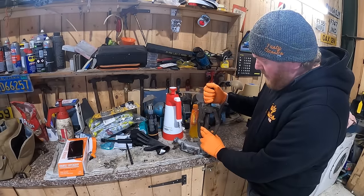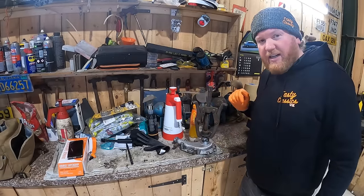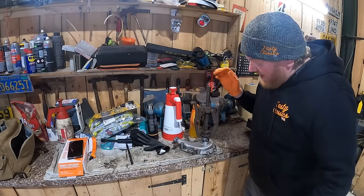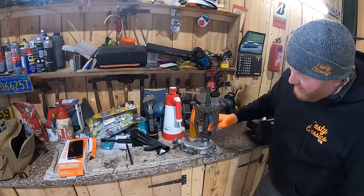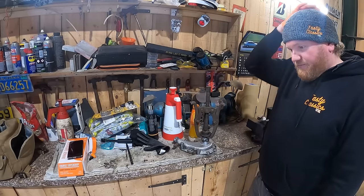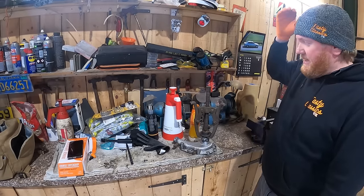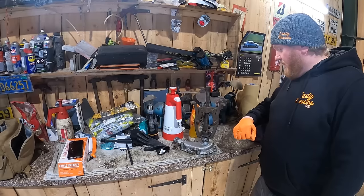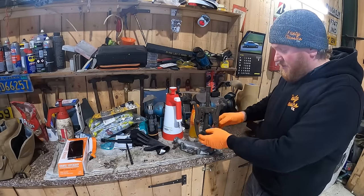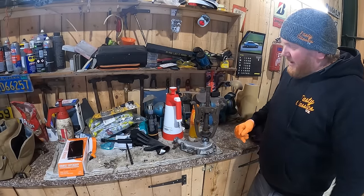Anyway, this is the water pump, and at the top of it sits this big, sort of bondage looking device. This is in fact a big bearing puller. The idea is that this bit touches on the shaft there, and these bits just very easily pull that out. Has this ever happened very easily in the past? No. Is this going to work now? Probably not either. There's no point sticking a load of plus gas in there to free it up, because all you're going to do is make everything slippy and difficult to handle, and that won't stay on. So you kind of just got to go in like this.